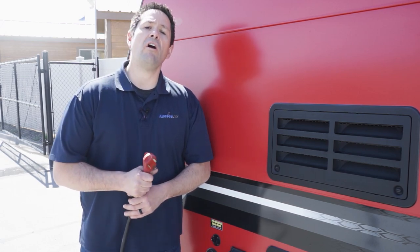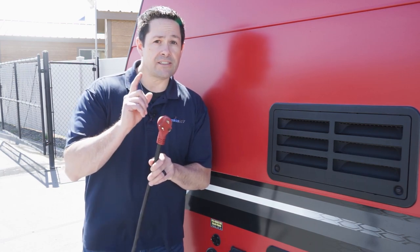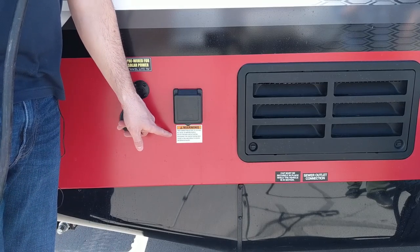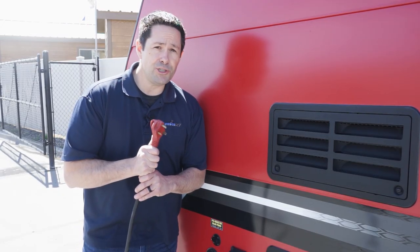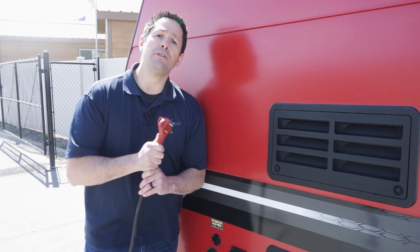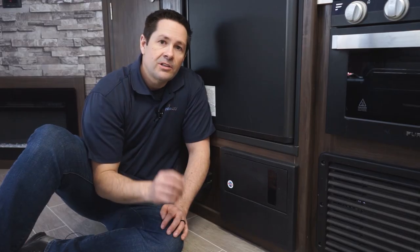A common question is whether your RV is 120-volt or 240-volt. If the plug on your RV has three prongs, that's a 120-volt system rated at 30 amps. You can see right on the inlet it clearly says 110 to 125 volts. Do not plug this into your dryer receptacle at home — that is typically wired for 240 volts and you will have a very bad day. Microwaves, converters, and many other things can be damaged. If you want this receptacle at your house, have an electrician install a proper RV receptacle wired for 120 volts.